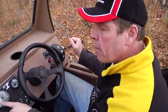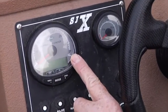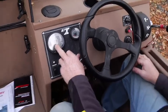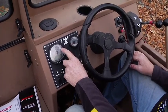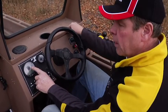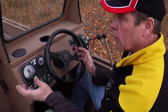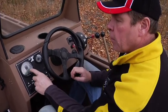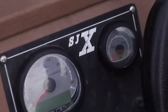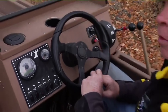The boat has the SmartCraft gauge which comes with the SJX — it's about a $700 or $800 gauge, top of the line with a multitude of features. On the RPM, your boat's going to run at wide open throttle governed to about 5,500 RPM. Your best fuel economy is in the 3,800 to 4,000 RPM range, typically five to six gallons an hour, which is excellent for a boat with this kind of horsepower.